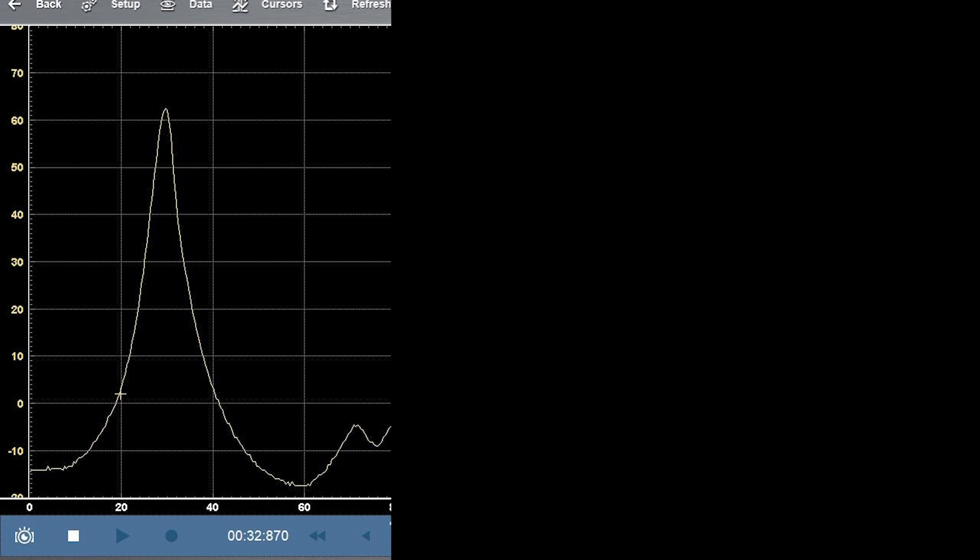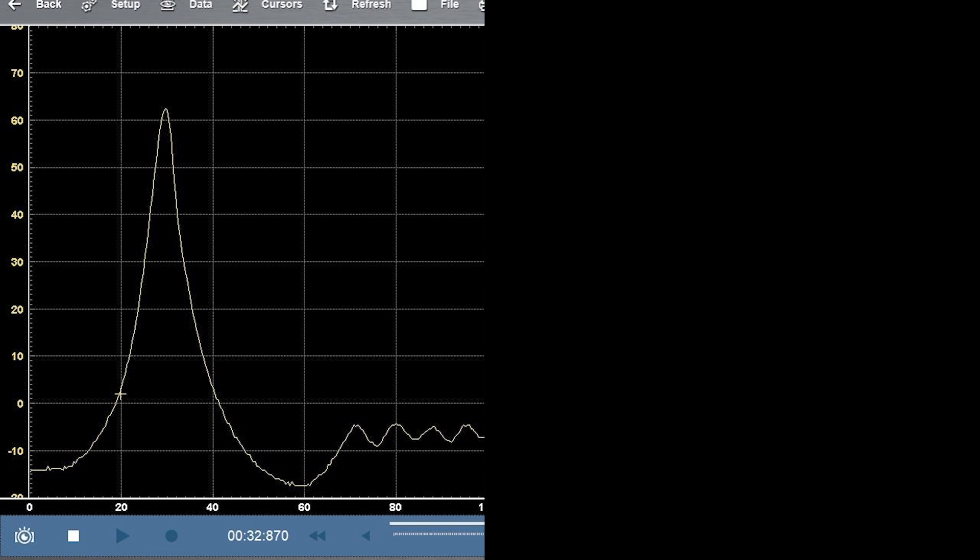Let's take a look at the basic elements of this pattern, starting on the left. You can see the pressure begins to rise as the piston nears top dead center of its compression stroke. In our capture there is no combustion event, so as we pass TDC and start working back down on what would be the power stroke — let's refer to that as the decompression stroke — the pressure begins to drop as the cylinder volume increases on its way to bottom dead center. Near bottom dead center of the decompression stroke, the exhaust valve begins to open, and you can see that ramp up as the cylinder pressure is exposed to the pressure in the exhaust manifold.